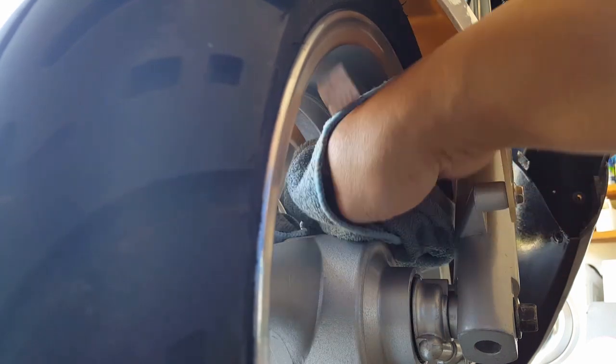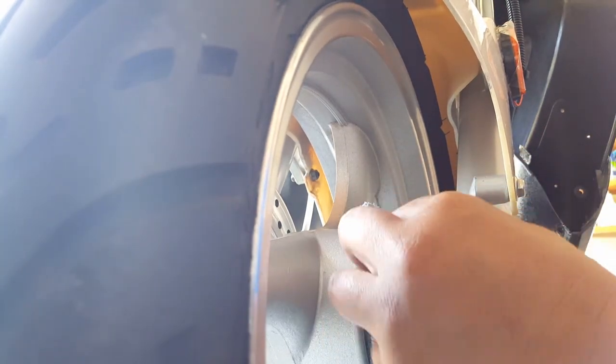Even when you're spraying your metal gasket for your cylinder head, you might want to use rubbing alcohol to clean that first before you apply that copper spray. That'll probably stick better if you have a cleaner surface for the spray to attach to. And also it could be because that can is probably a year old. It's been used prior, a year ago, and it's probably leaking. Maybe that's why it's not that great. People don't expect you to use a year old can for copper spray. Figure you'd have used it by now, right?